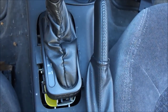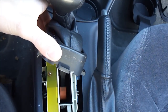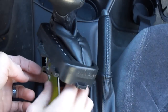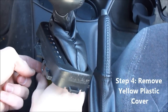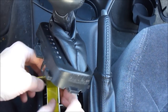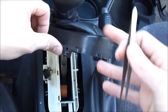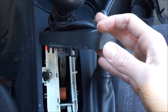Now that this is off, let's see what this light looks like underneath. You can see there's this plastic housing, a plastic piece over top of everything. It looks like this comes off pretty easily, and you can see I can bend it up slightly — it just snaps right in. So I'm just going to pull that out, and you can see the bulb underneath here. The bulb is located right here — it's this little gray silver-looking thing. You can see it's burned out because normally it wouldn't have that silver hue.